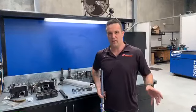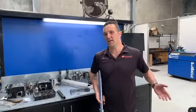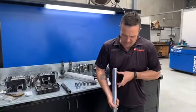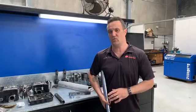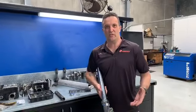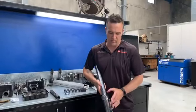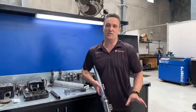They'll just stick a quantity of oil in it. Harley or Yamaha might say 350 mils. That doesn't mean nothing. There's more to it, where the oil height is, how the air gets crushed up, how the spring takes up, and what grade of oil, and dealing with a fork that's not really great to start with, not knocking Harley forks, but this is a 30 plus year design fork. So we have to bring it in the 21st century. We can do that by putting emulators and things like that, but sometimes that's not even needed.